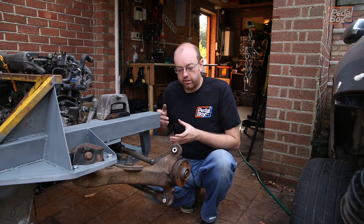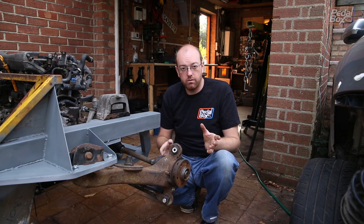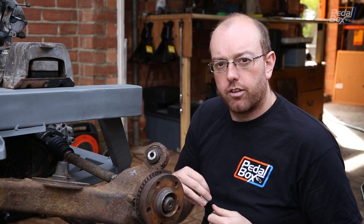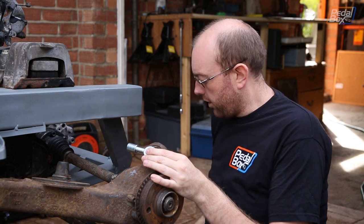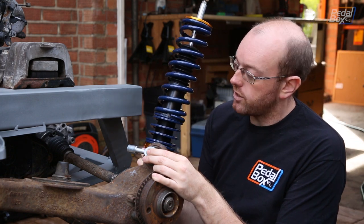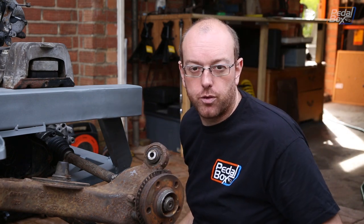The driveshafts extend and we had various rubber bushings that allow it to twist for toe and everything else — just too difficult to work around before. The other components we've been waiting on are our rod ends or heim joints, and tube inserts so we can screw these in and weld them into the end of the tubes to build our arms. We also need our suspension to know where it's going to sit and what we need to do to avoid hitting the springs through its range of motion.